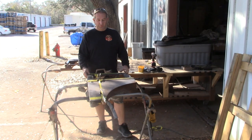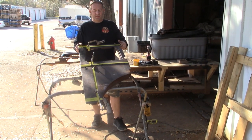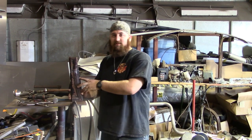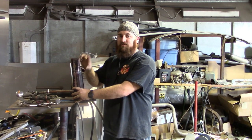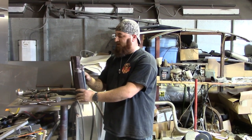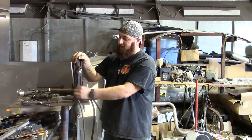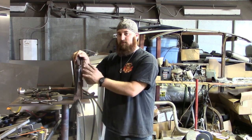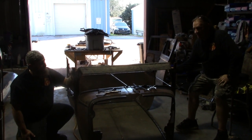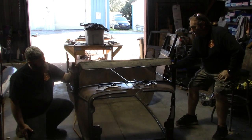We're just playing around — we've got the pieces left over from the two doors we cut. I now have a little quarter door if I wanted to make it like a three-door, like on the S10s. We've got the A-pillar for the '30s. I had to cut five inches out of it and do a couple of pie cuts just to get it right — see how narrow it is here and how wide it is there. That transition is real smooth. With a visor on and a five-inch chop in the front, I'm not going to have a lot of windshield, but five inches is working well for us.